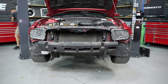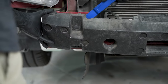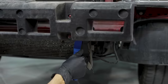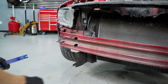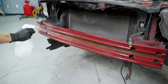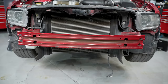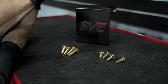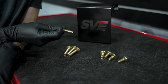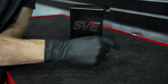To get started, first remove the front bumper. With the bumper removed, the push pins securing the impact absorber to the crash bar may want to pull through the absorber. If that happens, just pull the absorber away from the crash bar and then remove the push pins. Feel free to clean the general area while the bumper is off. Before installing the front bracket, note that the kit has two different carriage bolt lengths: longer bolts are used with the spacer plate, shorter bolts without.